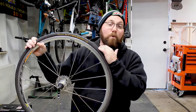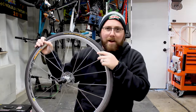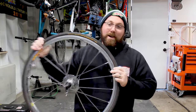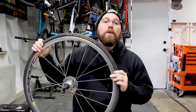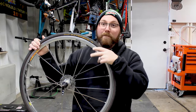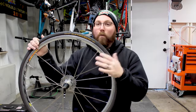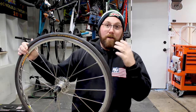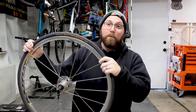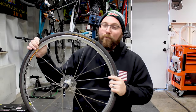I've made a whole video about what size tire you should run on your road bike, so check that out if you want to learn more about road bike widths. But back to Gatorskins — why don't people like them? It has to do with the heavier casing. Because of that heavier casing, they have a bit more rolling resistance and they add more weight to your bike. These definitely aren't the lightest tire you can get for a road bike.